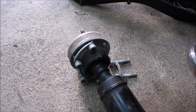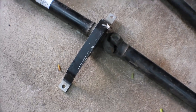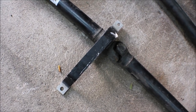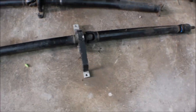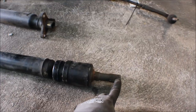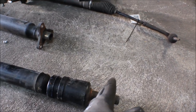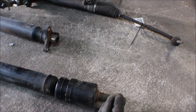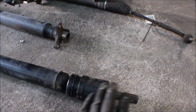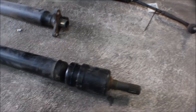You have this T45 Torx that sits in the differential in the rear. You have these holders, bearing holder, bushing holder, that sit with 13 millimeter bolts. You've got two of these, and in the front you just pry out the axle. You don't need to undo the bolts, then drain all the oil, which is really unnecessary. I saw one video on YouTube that did it. That is completely wrong. You just pry this out and install the new one.